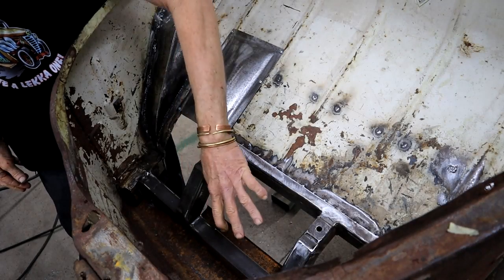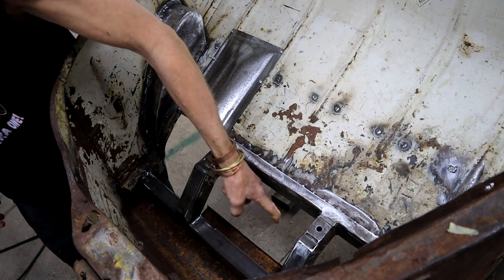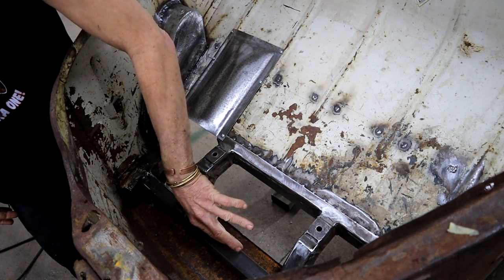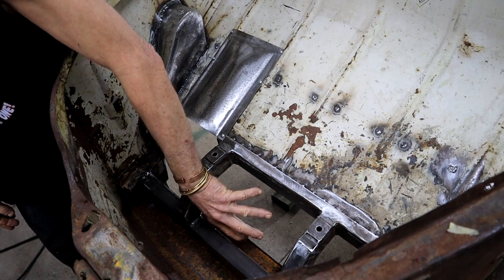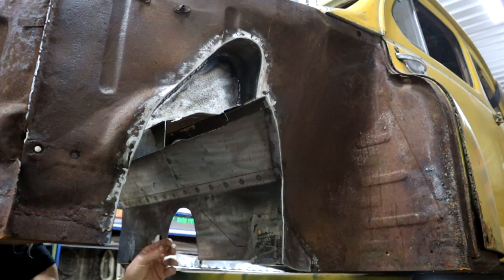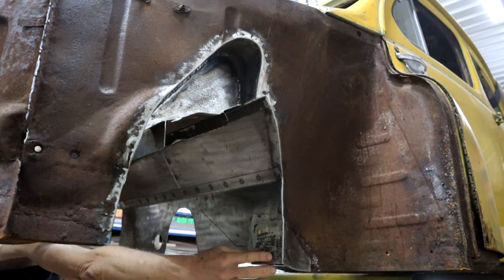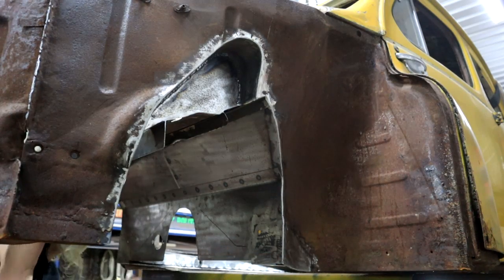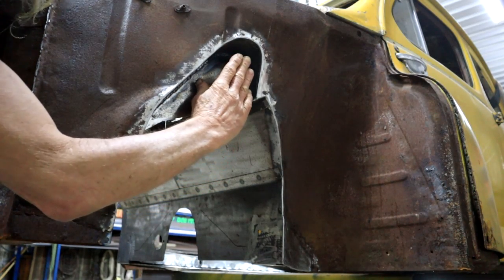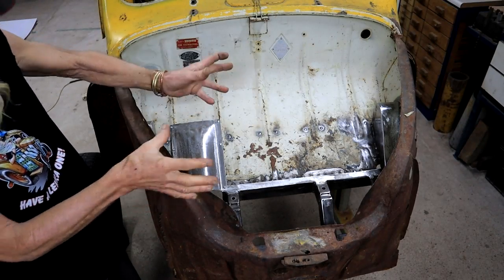So I've been thinking for quite some time now what I should do about this opening and whether I should cover it up. This here is where the suspension, the front beam sits. Steering box right here. It's not like this opening goes through into the cab, if I can put it like that. If you have a look in here, you can see here's the new section of the firewall I built. So the tunnel from the floor pan will come through here. This is an attachment point for attaching it to the cross member on the floor pan. Same on this side. And then this recess here, that's where the shock tower sits. Somewhere there. So I figured it will probably be a good thing to have a spare wheel in Mummy's car.